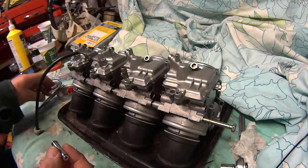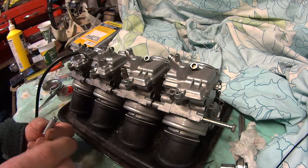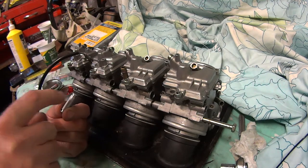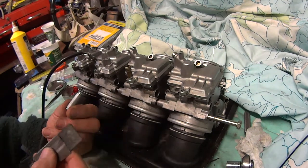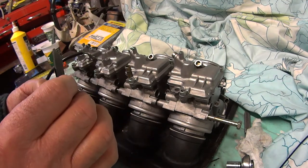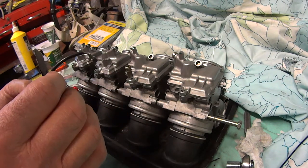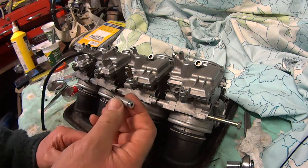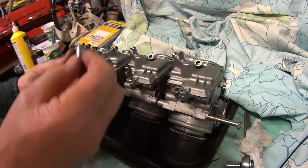But do make sure when you take these off, I made a mistake. I used a screwdriver to get these seals off, which means you mark these inside and then they'll never seal once they've got little marks. So if you've got a bit of 1200 grade wet and dry, you can actually get in there with a bit of plastic, a spacer or something that will fit in. You can polish those out, any marks you've got, and then you can reseal them, get the seals on there, these little seals,